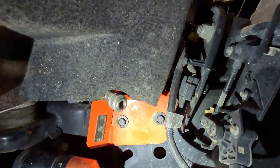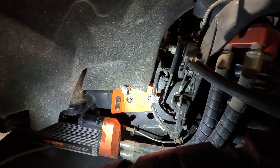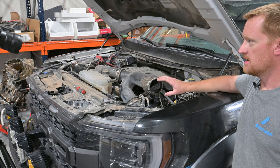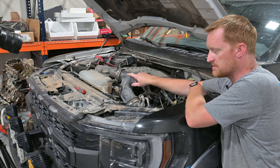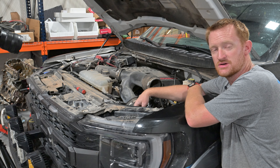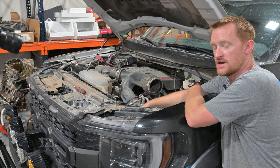So this will sit like this on the frame — truck's forward. This part of the hose comes over and we'll put it through here. These parts are optional; if you wanted to create your own way to do it, you could. This bulkhead fitting goes through the plate. Don't forget your Teflon tape and all that. This fitting goes on there, and then your quick coupler goes on the other side of that bulkhead fitting. This will point out towards your driver's side tire — that's how it pre-assembles.